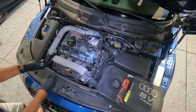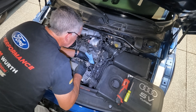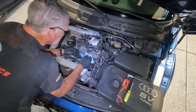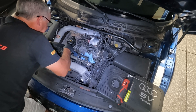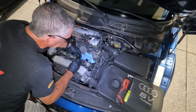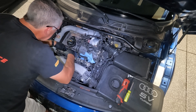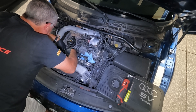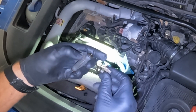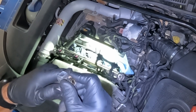So here is my new injector and we will go in reverse order — from four down to one. You just want to make sure it's in nice and tight. I've put the adapter on there. Number four — well, actually it's number one, but this is the last one going in. Make sure all those adapters are on nice and tight. Now don't forget to reinstall these clips, which go in from the front to the back. These holes on the side of the clip attach to the conical part of the fuel rail, and there are grooves on the side of the injector, and then the clip just slides in like that — and that's what holds it in place.